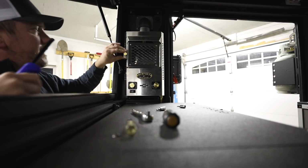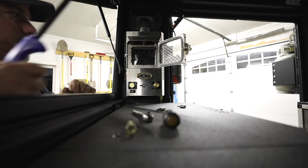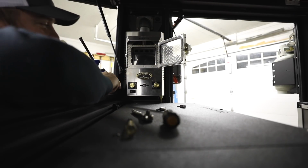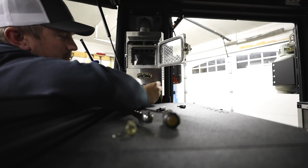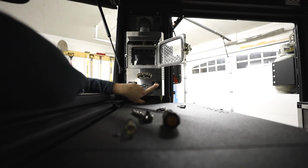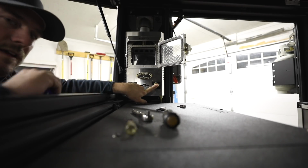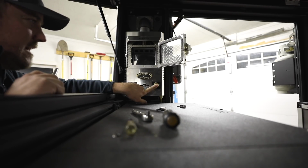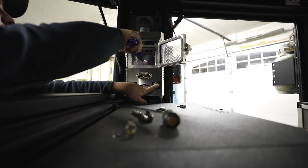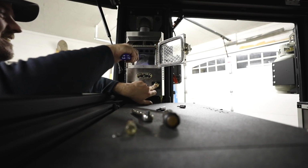So AJ said all I need to do is open the door. That's kind of like a little miniature fireplace. It's got like a gasket ring around it. Put it on low, hold the gas down, and wait, I guess. So this is the first time we've had gas in the line, so it could take a little bit. Bingo. Oh, I gotta hold the pilot down.